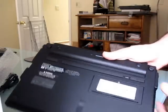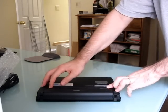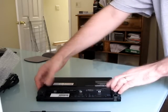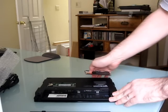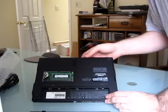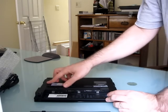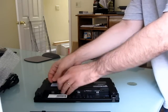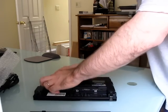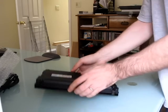On the bottom, one of the things that's really interesting about this particular model — if you squeeze together the battery release, the battery pops right out. But if you squeeze them again when the battery's already out, the RAM access panel actually opens right up. So you don't even need a screwdriver to upgrade the RAM from one gigabyte to two gigabytes. Like most netbooks that ship with Windows XP, this model does come with a single one-gigabyte module, but you can upgrade quite easily. Getting it back in is a little bit harder than getting it out — so let's pop that back in.